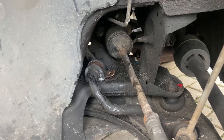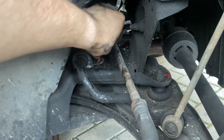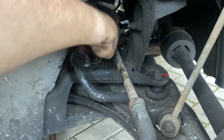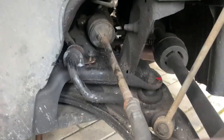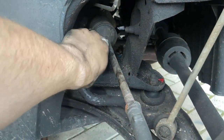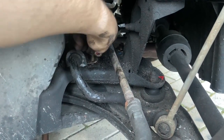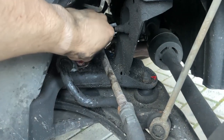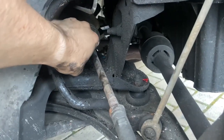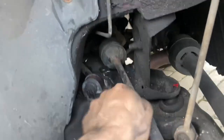That is pretty much job done. Now you can bend this bracket tab back down very simply and put the bolt in. Now you've bent that back down into place - there's a little bit of a gap but that's alright, because when you thread the bolt in and tighten it up it will pull that down and pull it square. Just make sure your bolt goes in straight - mine's not quite right so back that off a little bit and keep wiggling it around. It won't really want to go in that squarely because your bracket's slightly bent, but just keep working with it and it will go in squarely and pull it down properly. That's practically there now - see how it's pulling it down.